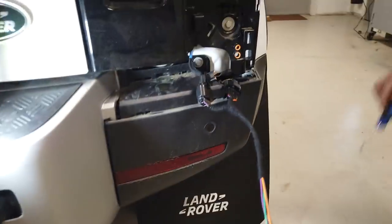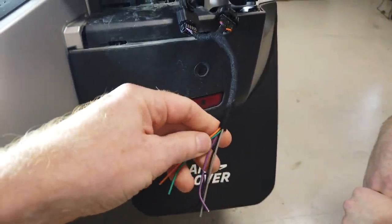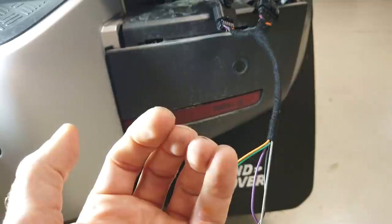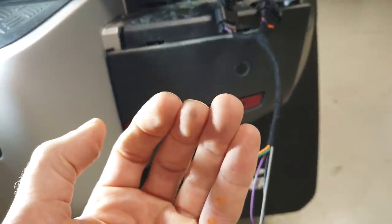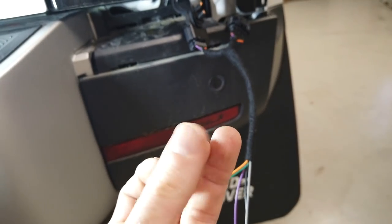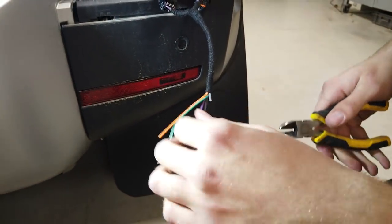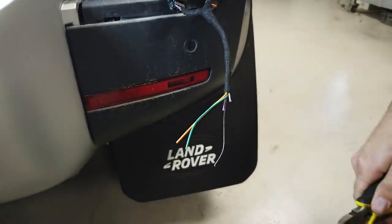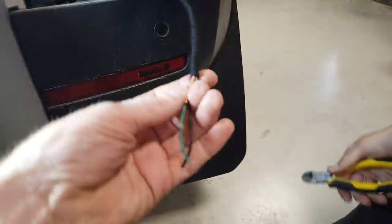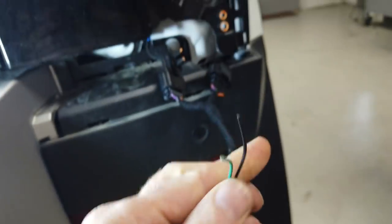Tyler's clipped it all together — you've got male and female connectors. We're going to cut off the wires we don't want, but make sure you cut them at slightly different lengths. If you cut them all the same length there's a danger they could short together, whereas staggered lengths let you tape them up safely. Leave the black and the green, cut the rest at little steps so the ends don't intermingle, then tape it up — no chance of those shorting out.